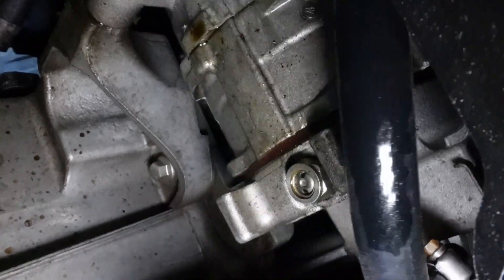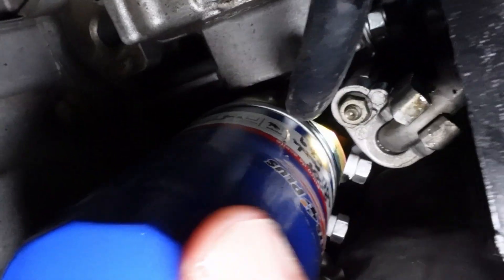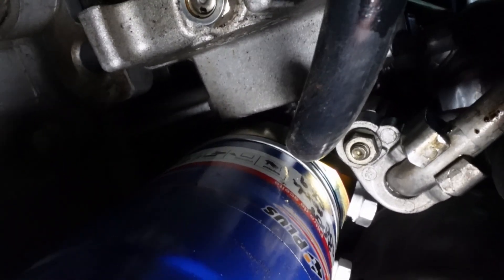This is the first time I've used a sandwich plate adapter. There are three ports on this — I've got two of them plugged and then a 90-degree fitting coming out with the supply. I probably should zip tie that better because it's hanging down too much. But it was really easy — just get the right threads for the sandwich plate, put it on, then put your oil filter on top. Worked out great.